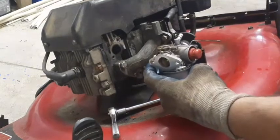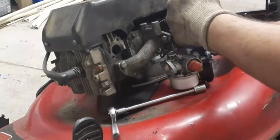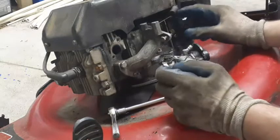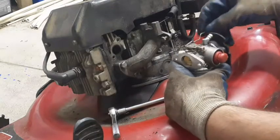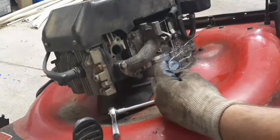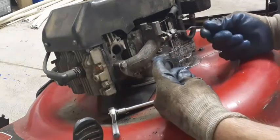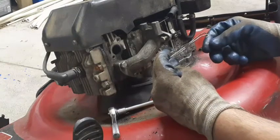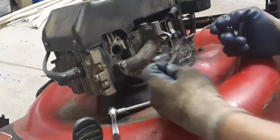So, what's the problem here? Does this work without restriction? Yes, seems to work. How about this guy? Okay, let me verify. This is the link that was on here with another one I have. Let's see if this guy's bent. This is what I took off. And yes, there is a difference. So it looks like it's bent out, so that could have been causing that problem.